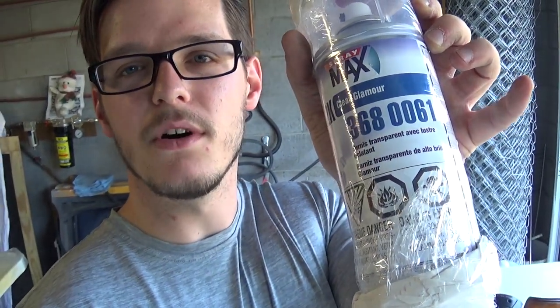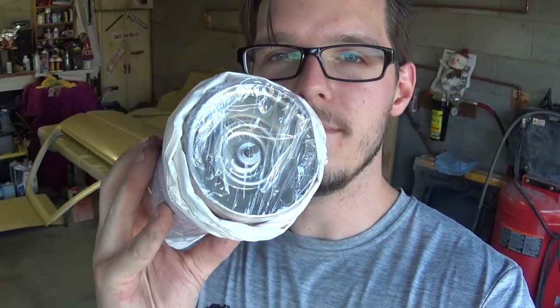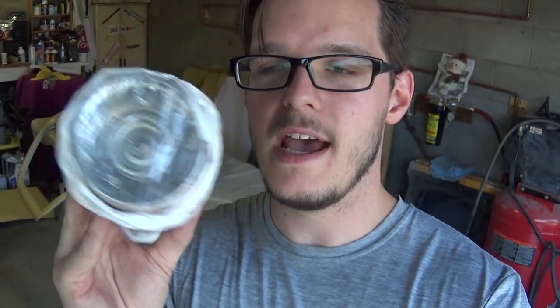In order to clear coat, I'm gonna be using this clear coat from SprayMax, and I've got the number right there in case you all want to check it out. I'll put all of these products in the description as well. The really cool thing about this clear coat is that it is actually automotive grade. It has an activator in it as well. You pop the bottom and release the activator into the can of clear coat. So this actually sprays out as an automotive 2K clear, with the clear and the activator mixed in one. So that's a quick overview of the process.